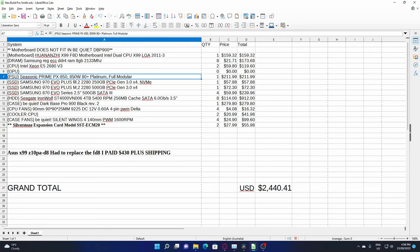The power supply I had is a failed power supply — it kept tripping out due to the 3090 transient spikes. I blame the power supply, not the graphics card. A Samsung SSD would make a reliable drive for the operating system, which will be TrueNAS. I'll install TrueNAS onto that.